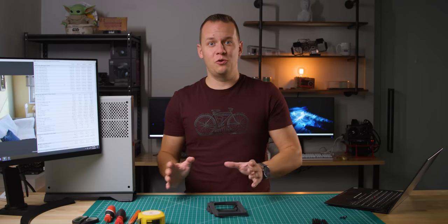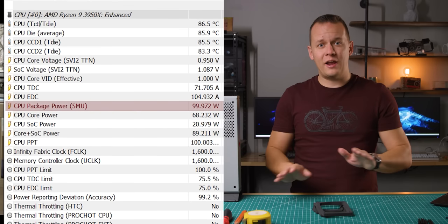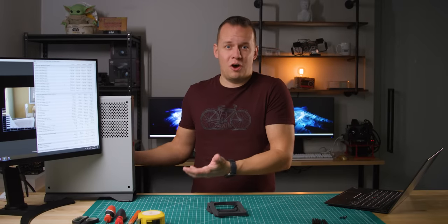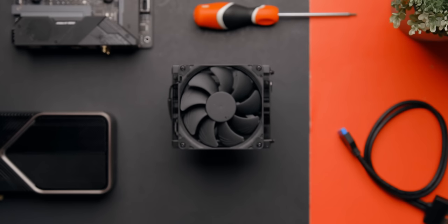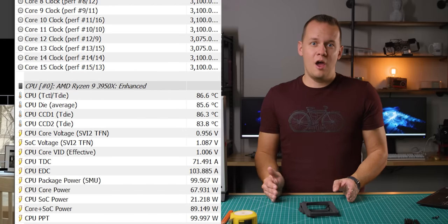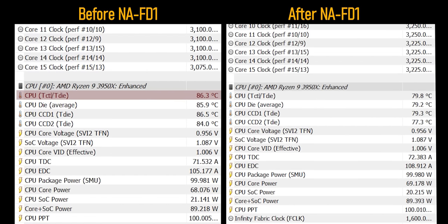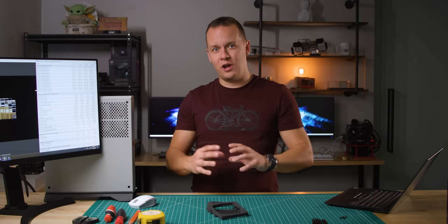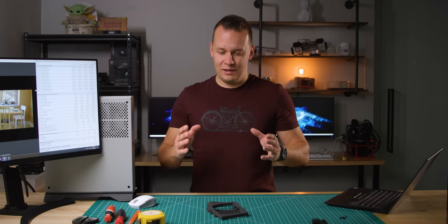With the system running next to me, I want to give a quick update. Instead of running the 3950X in eco mode, I've tuned it to run at an all-core load of 100 watts continuously. I don't run it at that load very often since I'm mostly gaming on it. Under that all-core load, with the L9A at about 60–65% fan speed, I was seeing between 86 and 87 degrees on the CPU. Checking live now, temperatures are almost 5–6 degrees lower at between 79 and 80 degrees. It's not recirculating interior case heat anymore — it's getting fresh air from outside. So yes, it actually works.